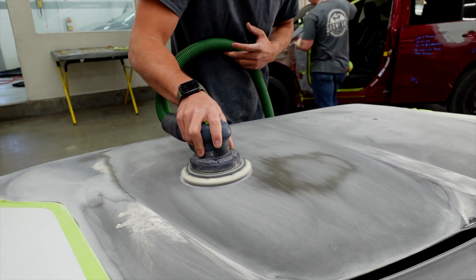We have the center of the hood masked off, so we have to come in and use this special tape here — it's called fine line tape. You put it right on the edge of where you're going to be making that transition. When you peel it off, because it's very specific tape, you get a really nice clean line. If you use regular masking tape, it'll bleed underneath — this will not do that.